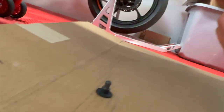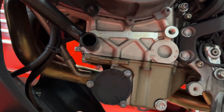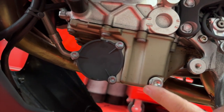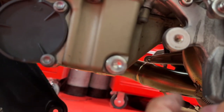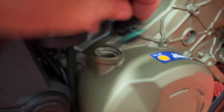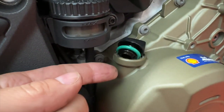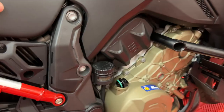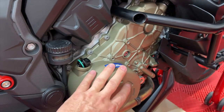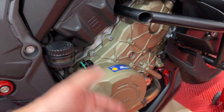There's this side, there's the screw. Don't forget the little rubber bushing in here. Once you drop this down, you will expose your oil filter and it's easier to get to your drain plug. You don't have to do this, but I like to take the oil fill plug out, take a look at the O-ring on it, and set it off to the side so that you have some airflow to help it drain a little bit quicker. You want this engine warm — not super hot where you're going to burn yourself, but not cold. This way the oil will be thinner and come out quicker.